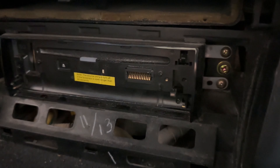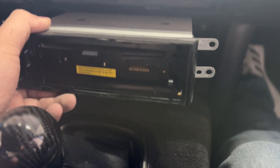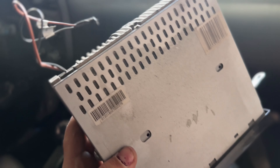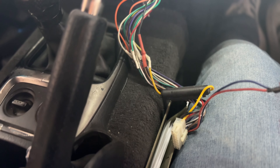Let's hope it's not a mess of wiring back there. All right, now that we've got those four screws out, this will just slide right out. You can see back here it looks like everything was done decently — thankfully. So that's going to be fun to wire in the new one. Now we're going to go ahead and unclip this guy. And just like that, we have the old head unit out. Let's see how the new one's going to fit.